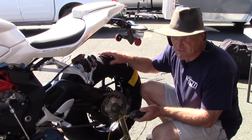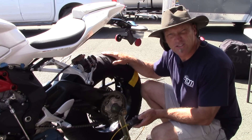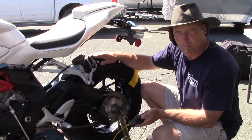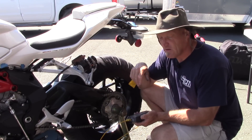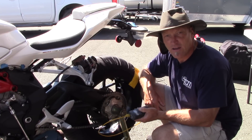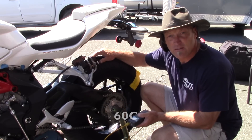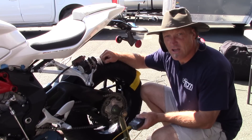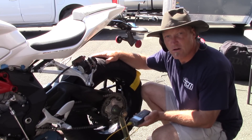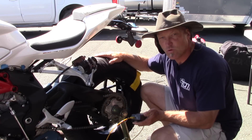At this point today, am I going to check it again? No. I know I'm at 200°F in the front and 170°F in the back — that was near the joint, so pulling further back is a truer test. I'm good for the day, I'm good for the next month, and I'll check it again after that. If my warmers drop below 140°F consistently, they're done — time to get a new set. These are items that will wear out, so check them frequently to keep yourself safe. Always have data points on your warmers.